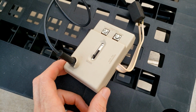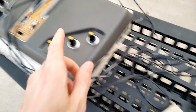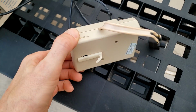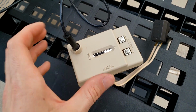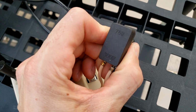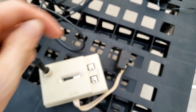So this is the RF box that comes with the console. If you don't have this, you may have to just take it apart using the flat head underneath and fashion something that way. There's a few videos online. If you do have the RF box, you only need the 300 to 75 ohm converter here. They're around $5 on Amazon. I'll link it in the description below.